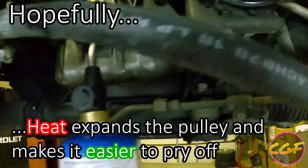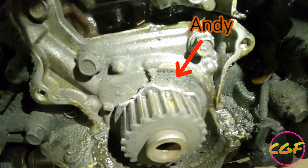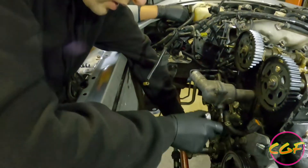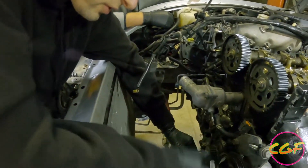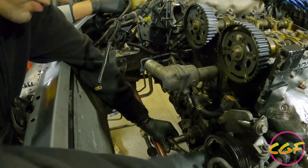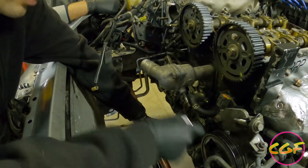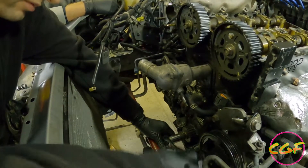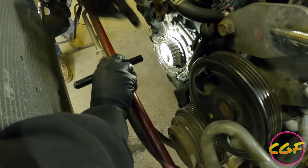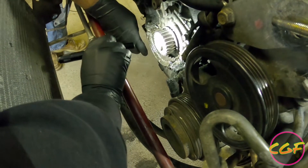The only problem is once we get the slot we're going to have to bring the car back down. Right now we are putting a bolt in here in the hopes that it bottoms out before it runs out of threads, and then we're going to use that to turn the crank itself so we can put the broken keyway toward the top so we can try to drill it out without messing up the crank. This is Plan B.